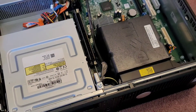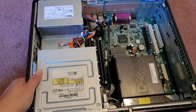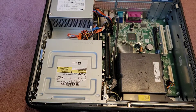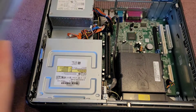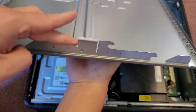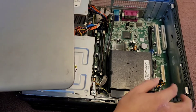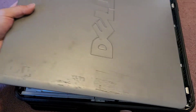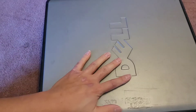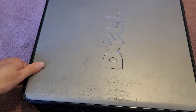All that's left now is to put back the cover, which is very easy to do as well. The cover — you want to make sure you get the top and the bottom right. The bottom has these two holes in it, and the top has this. You can also see the Dell logo. You line up the two holes with these holes there at an angle like that, and then you just drop it down and push it into place. And that's pretty much it. Hopefully this video helped you guys. If it did, make sure to like, subscribe, and share my channel with others.